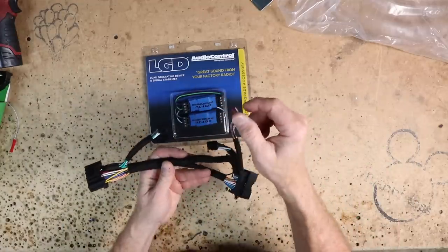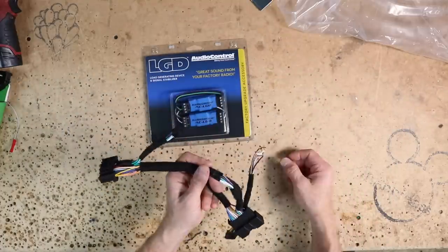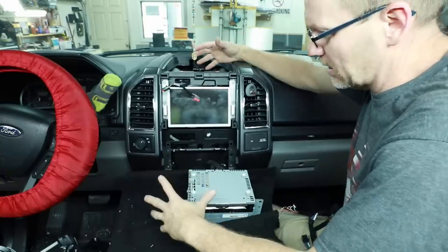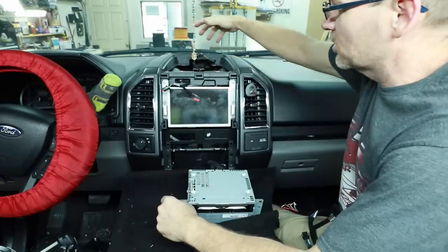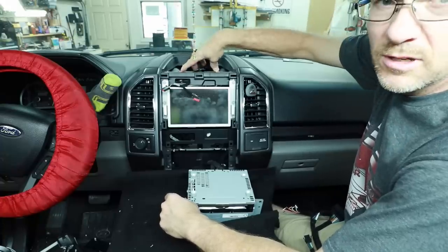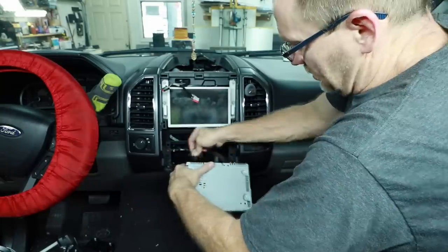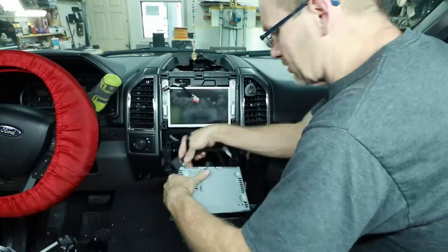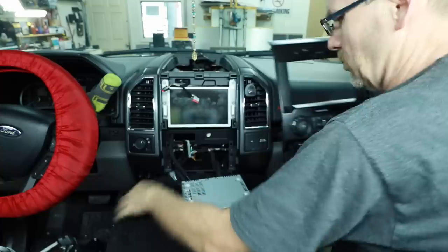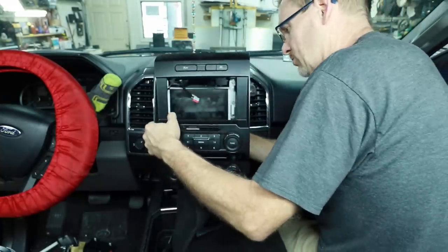Now we need to take the T-harness into the car and do some testing. We don't want the speakers to be playing, so you either have to have all the speakers out of the car or have them disconnected from the radio. We've already taken the radio out of the dash — quick refresher: pop the grill for the center channel off, there are two 7mm screws there. Pull that whole piece off, two more 7mm screws here, this whole piece comes off. Then pull the four 7mm screws, slide the radio out of the dash. Unplug the main harness and insert the T-harness between them.